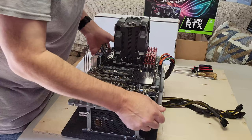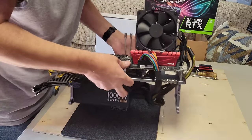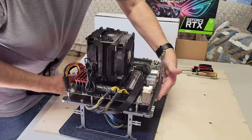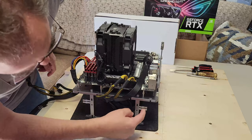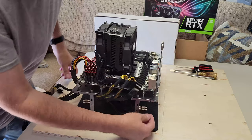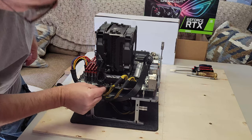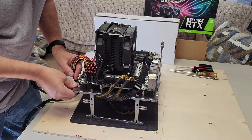I need to put in an operating system and verify that everything works. A little bit of Velcro to tie the cables down. A couple of things to note: these little things here are the motherboard standoffs. You can choose to have either the pegged ones or the screw-in type, but there's only eight of each. A typical ATX has nine mounting holes, so one of them is just resting on top of the screw-in one. They have a couple of extra screws here to plug stuff down with.